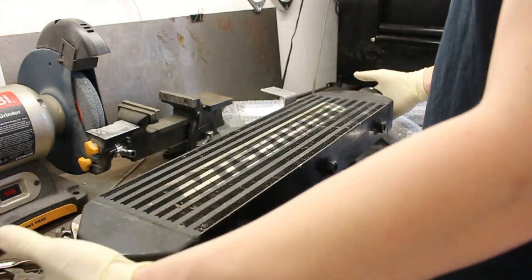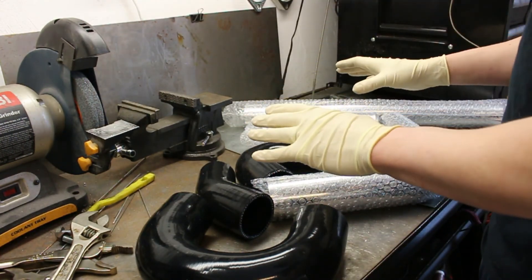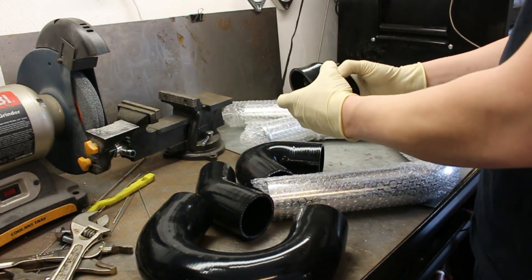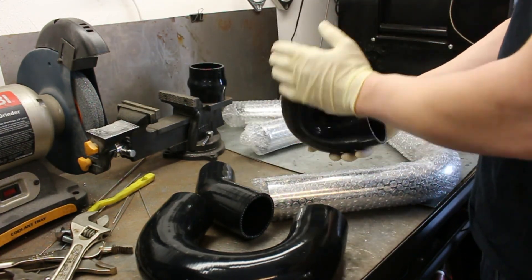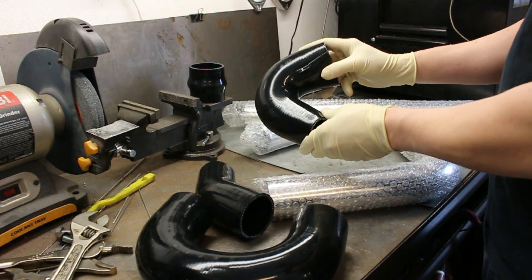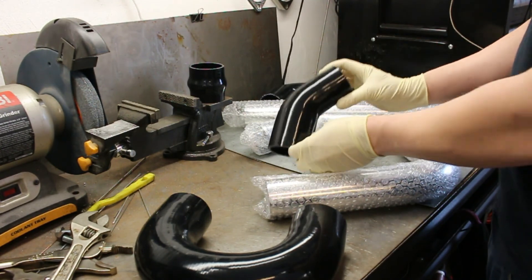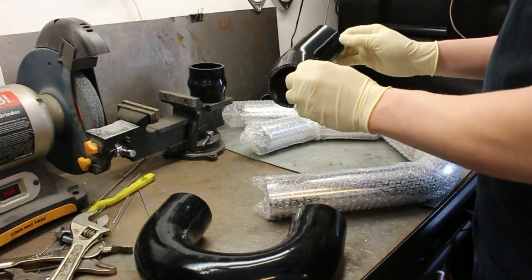So to do this, you are going to need an intercooler. You're going to need a varying selection of pipes and couplers — and this will save you a ton of frustration and money. Starting with the smallest coupler, you're going to need a 2½ inch inner diameter hump flex coupler, or just a straight 2½ inch coupler at least 3 inches long. You're going to need a 135 degree 2½ inch inner diameter coupler — it has to be 135 degrees. You're going to need a 2½ inch to 2.25 inch 45 degree reducing coupler. This coupler is kind of hard to find, though I will put a link in the description where you can get all of these in one place for pretty cheap.